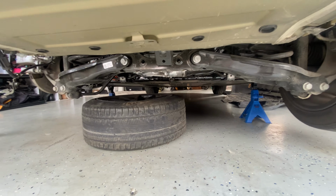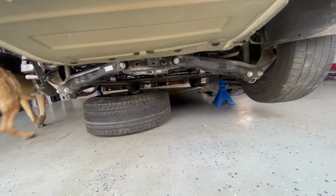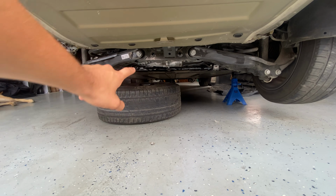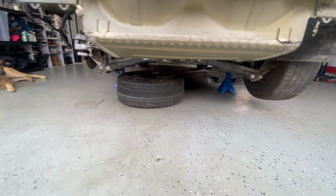But that motor over there is not small. I think it's pretty big, so I'm probably gonna have to run to a store and get a big old jack, one of those transmission jacks or something. But what I'm gonna start with right now, I'm gonna drain the coolant, just unplug any of the electronic components over there, and just start disassembling everything.